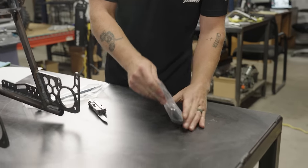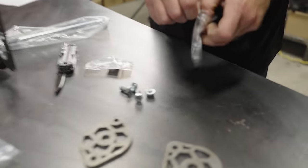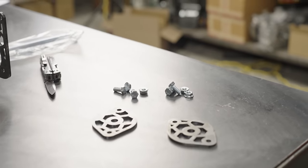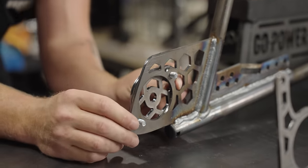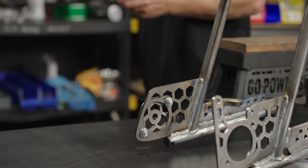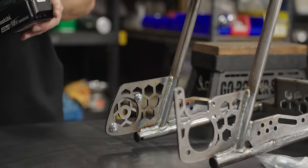Let's move on to the rear. You've got the axle brackets — 12mm axle brackets. Shoutout to the warehouse for labeling and kitting everything perfectly. I'm just going to bolt on one side. These are flanged serrated nuts — a lot of times you don't even have to hold a wrench on the nut because it'll bite in.